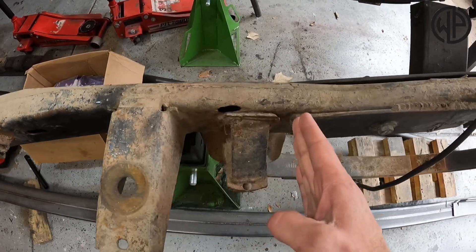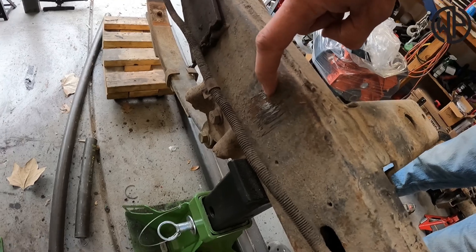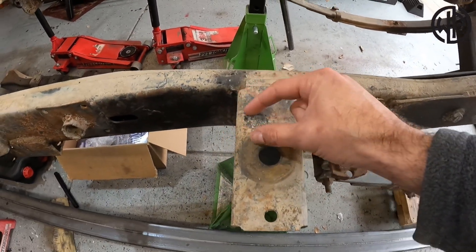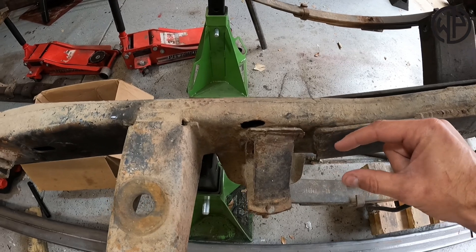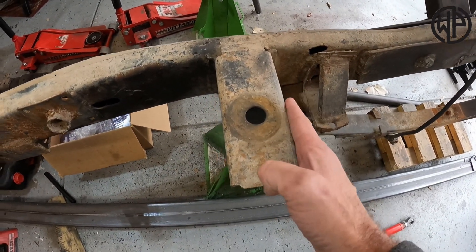But then I was extending it anyway. Because if you guys remember, I had a spot where my exhaust manifold — my header — was actually touching the frame. So I want to make the frame a little bit wider. I'm going to have it come all the way out to where this body mount is much shorter, just kind of have it come all the way out to here, past that part, and then curve it. So basically, the distance from here to back here has to be four inches longer.